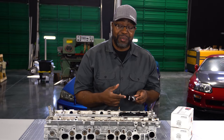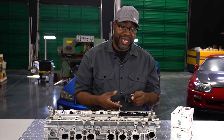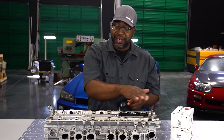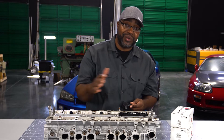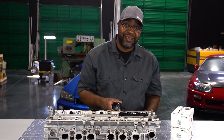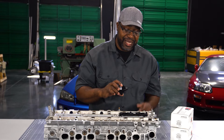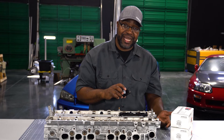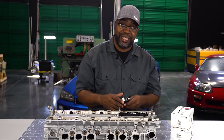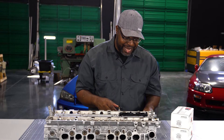You might ask how these compare to the larger IGN-style smart coils available from MegaSquirt, AEM, or Haltech. The main thing is that a lot of guys want a cleaner engine bay. These, as well as the 1NZ that we offer, are going to fit under your factory-style coil cover, whereas the IGN coils will sit up high. This makes for a cleaner install, and these things throw out a significantly high amount of spark energy — higher than what guys with the 1NZ are looking for, while still giving a clean install.